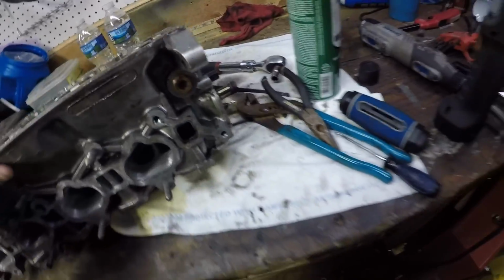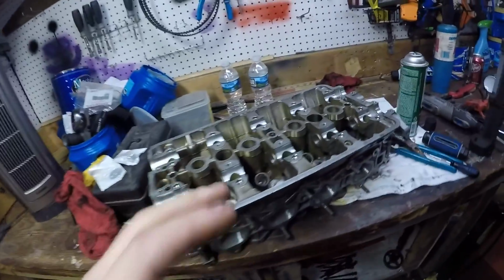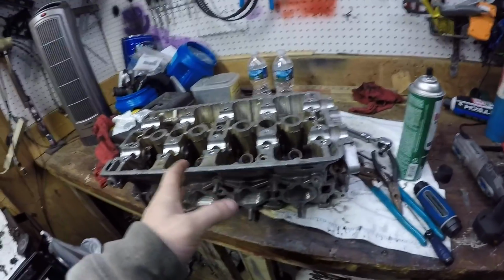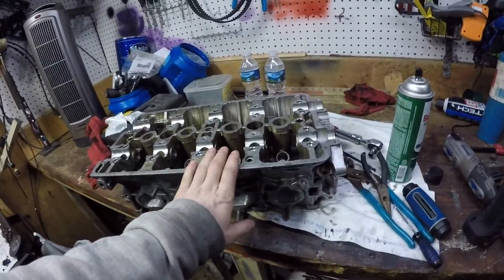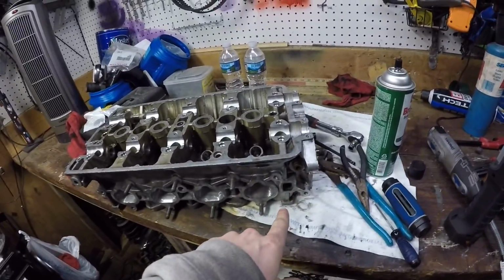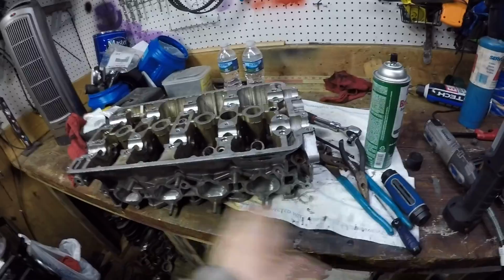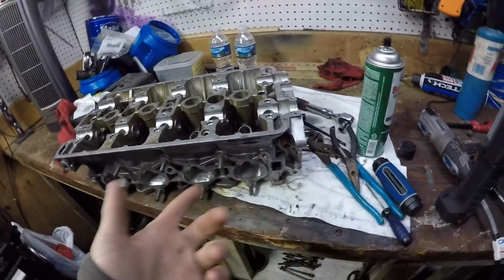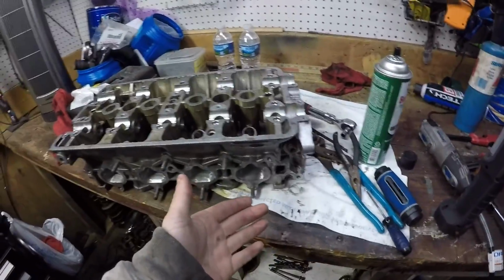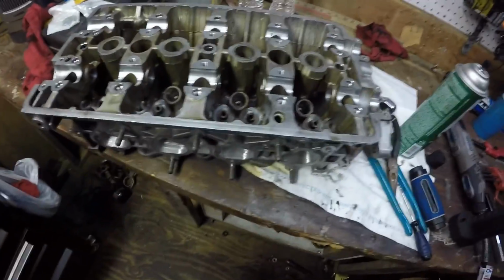I used one of these screws out of here. I just used one of those little black ones. It's a little Allen key one. So I gotta take this probably tomorrow. I'm gonna go look around to the machine shop and get them to level the head, and it's gonna cut that screw down so it's flush with the head, and I'm never gonna be able to take it back out. So since I gotta do that, I went ahead and took the whole head apart.